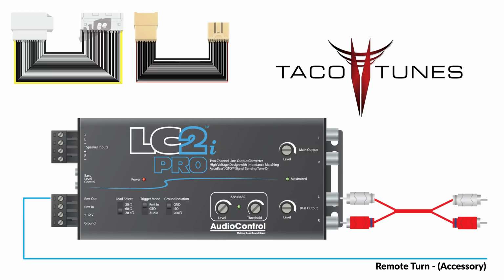As stated earlier in the video, this Add a Subwoofer integration system works with just about any brand amplifier. The plug-and-play Add a Subwoofer system provides a 12-volt remote turn-on along with left and right output low-level signal. Please note, in this case, you must plug both the left and right RCA cables into your subwoofer amplifier. The LC2i is performing some basic channel summing that is required to reproduce the lower frequencies.